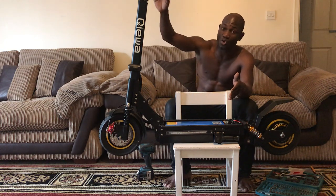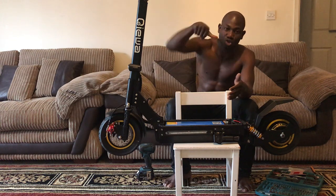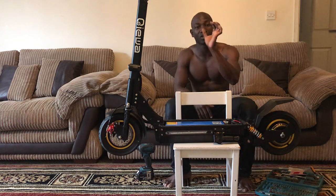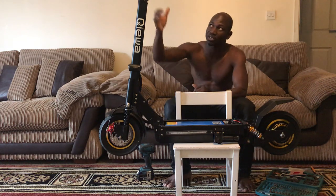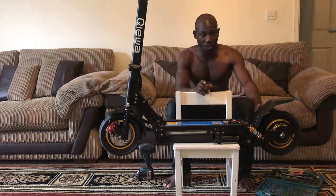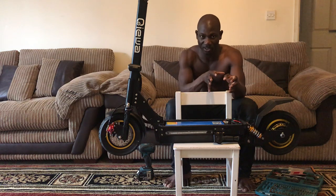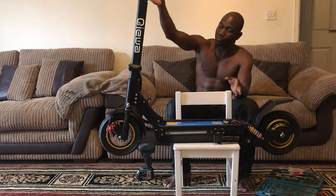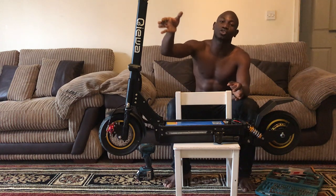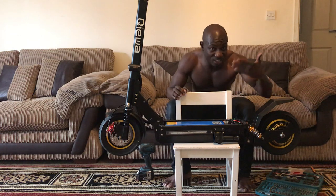What you're going to have to do is just press your power button, and don't just go straight, because it's a new controller. Maybe you haven't connected something carefully, so just press on it slowly to see if you have any effect on the motor. When the motor starts to turn, that means the new controller is working. Then you change the gear to 2 slowly, change to 3 slowly. And once you're doing that, try to see if you can smell anything, like anything is burning.